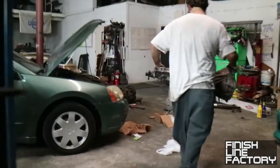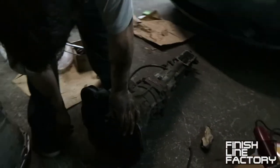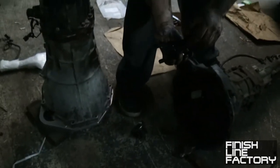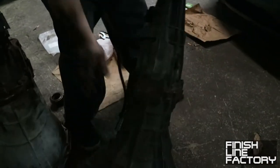Here's a strongman, Paul, so you can compare the bell housings. You can see how much larger the Z32 bell housing is. Look at that. So you reuse the clutch fork and the throwout bearing from the KA. The throwout bearing. A new transmission. That's it. I don't know if you need the pivot ball or not, but I guess we might have to find out.